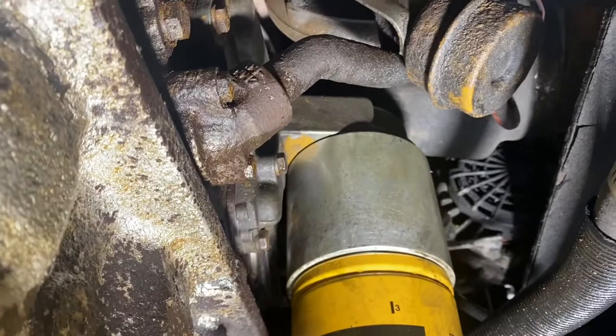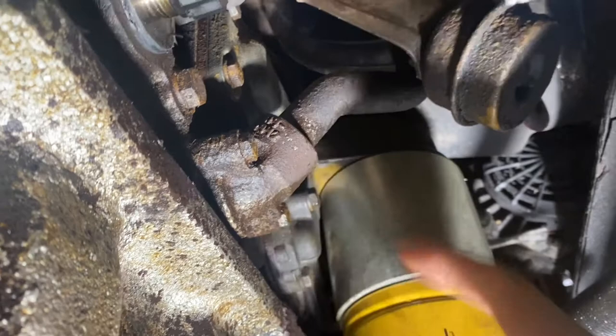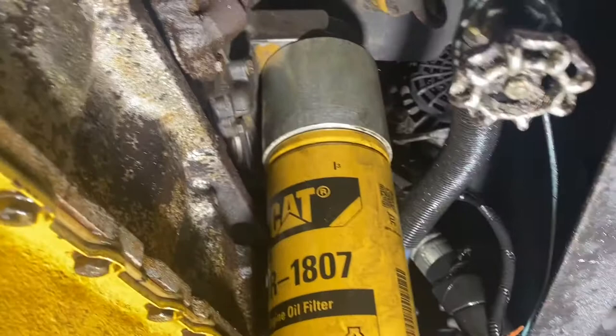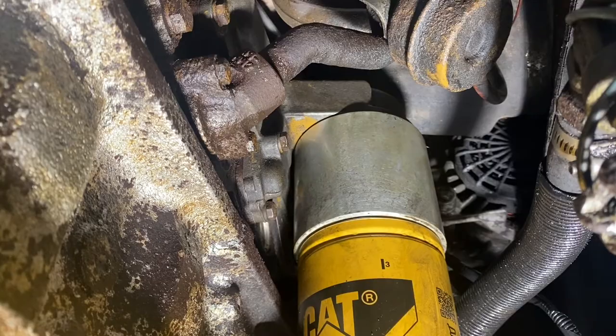In this case, it's the gasket. There is a bolt hole right behind this turbo drain and with the engine running, I can see the oil dripping off of that bolt hole. So I'm going to take everything apart here and show you what you need. For those wondering why my oil filter has this piece of aluminum on top of it, this is actually a custom-made sandwich adapter for a remote mount oil cooler — you can see these giant hoses. I'm going to do a separate video about that, but it means that taking this off has that much more work involved.